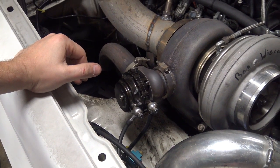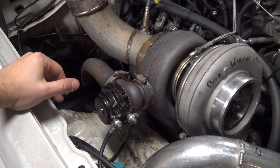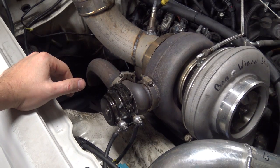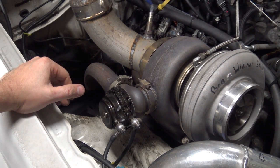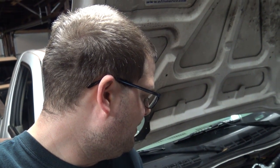I made 918 with adding a little bit more boost, and we're like, well, what the hell is that? We checked a few things, messed around, made another dyno pull - makes 900 again. I'm like, huh, what's going on? And then I start seeing weird amounts of boost - less boost than I think I would see, or less than I'm asking for.